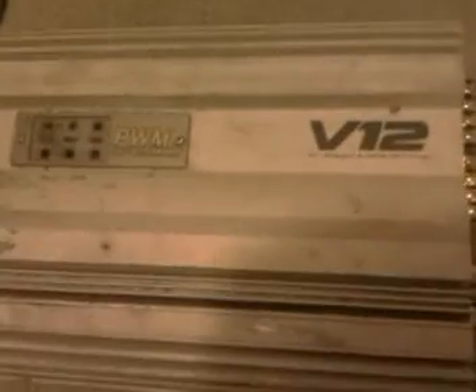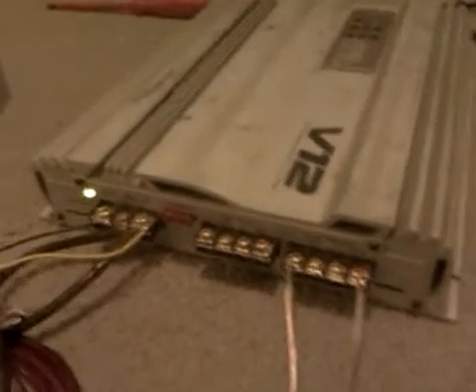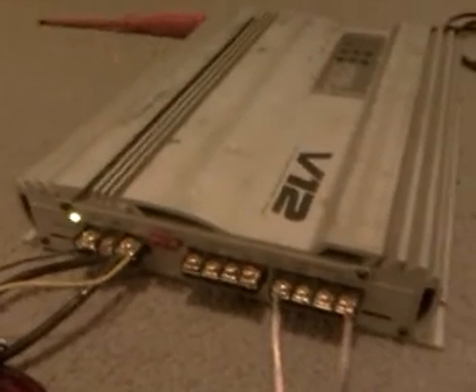The amp that I'm running here is a V12 DC Straight 1000 Watt 4-channel. These are your main types of amps. You're going to have a mono block, which pretty much means 1 channel. You're going to have 2-channel amps and 4-channel. All that means is it gets whatever the power of the amp is and it divides it by the channel.